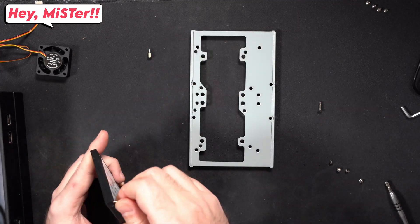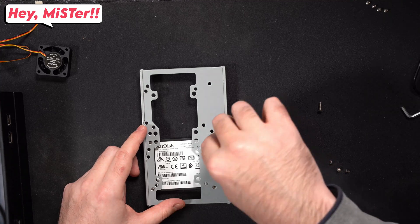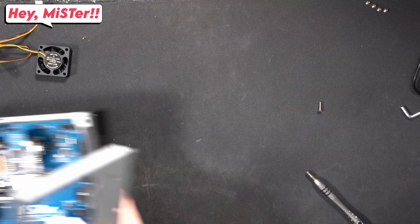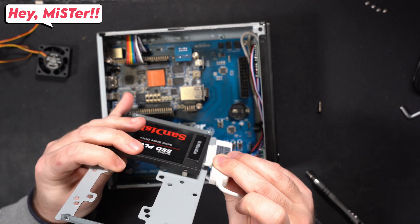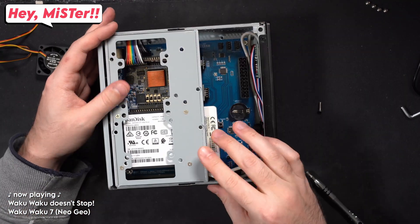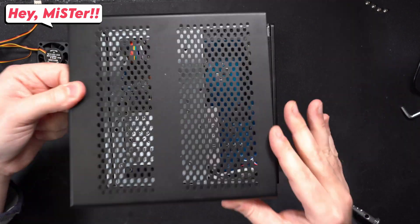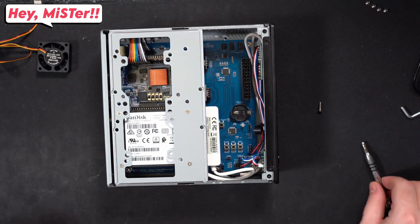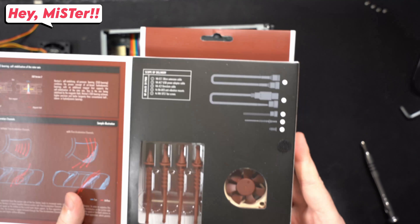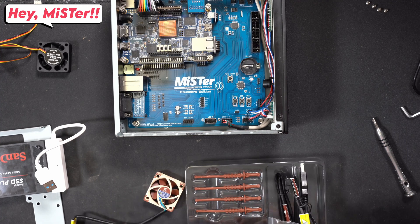At this point I applied everything I knew. I also had to add some standoffs to the SSD because the SATA to USB adapter on the front side — the side that attaches to the drive — wouldn't really fit. I needed a bit of extra clearance, which I also figured wouldn't be too bad for airflow. Then I decided to go with the Noctua fan instead of the black fan so I could utilize the PWM functionality of the Ironclad.